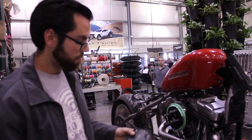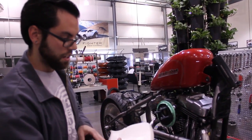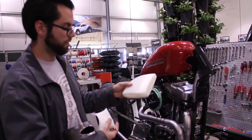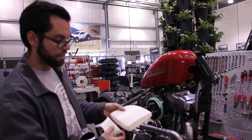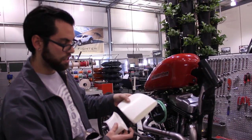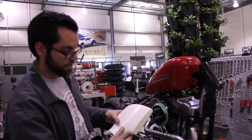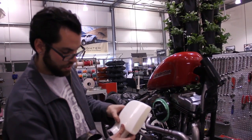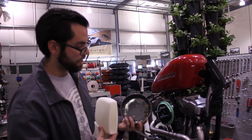This is one of our signature pieces on the racer. This is the intake and if you guys didn't already know, it is actually 3D printed. There are a whole bunch of other videos on how that process is done. But how this will come together is basically a two-part epoxy style glue that goes in between the two halves of the intake. I usually drill a couple of extra holes for reinforcement. This gets pinned together — you'll see there are locating pins on each of the halves — and then it eventually gets screwed and glued to the top of this metal ring that gets rolled.